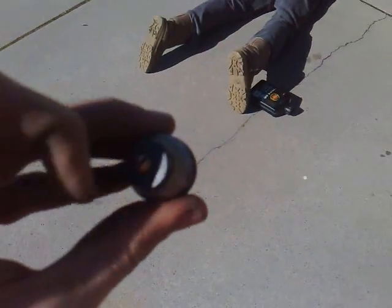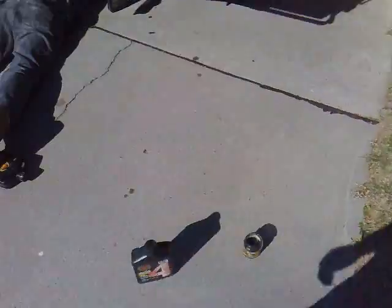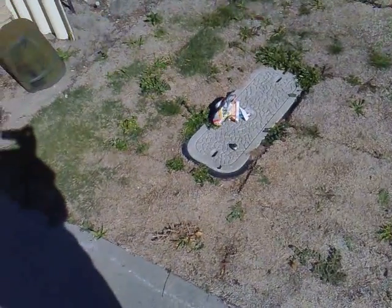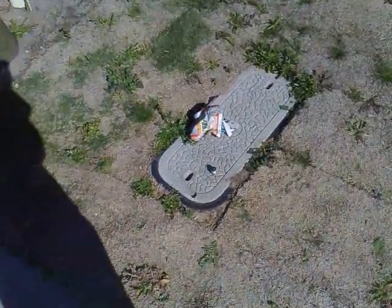This car's done 100,000 kilometers and a lot of thrashing, so a little bit of metal shavings — hopefully it isn't too bad, but it is a bit of a concern. Cleaning the plug and re-checking it, you can see if it's had any more shavings or anything else wearing. You can sort of see how fast it's wearing and if you need to do anything more after that.